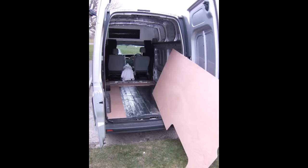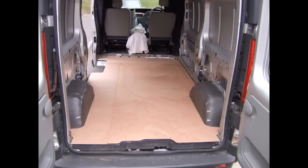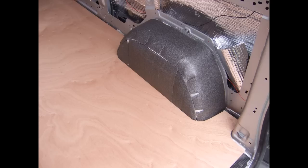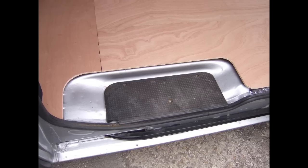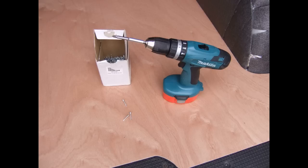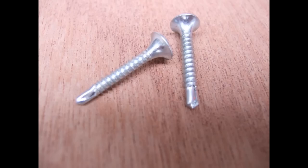Now I'm adding the floor. This was a floor and wall panel lining kit that I bought — already cut on a laser cutter specifically for this type of van. The floor was screwed down using self-drilling screws. It's nine-millimeter ply, and while I could have cut the panels myself, time was the issue and by the time I'd bought all the nine-mil ply sheets, it wouldn't have been much cheaper than the ready-cut kit.